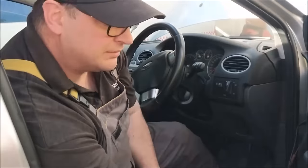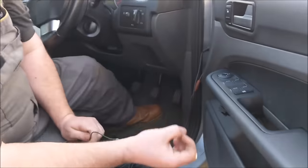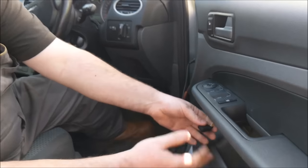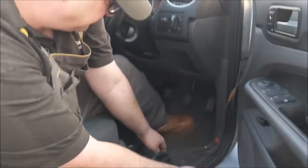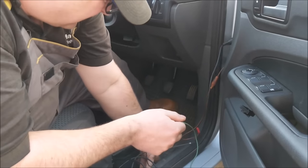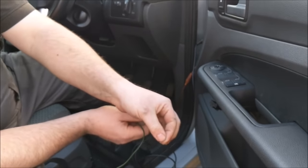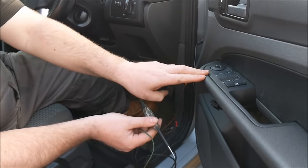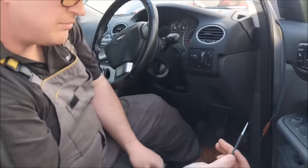What this switch is doing when you press it down — like any of these — you're sending a negative. It's looking for a negative, so it's like a pull-down system, and that's exactly what the module is looking for. When you press down it puts a negative to one of the wires, and that's what our test light is doing — you're sending negative from here through a bulb to the end of this, which operates the window motor. It's as easy as that.